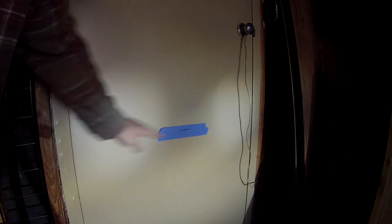Because I've got LED lights I've got two beams there, but now I've got the beam pretty much centered with that cross — whereas before it was way up high and I really wouldn't have gotten the right effect on the road.